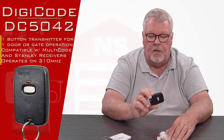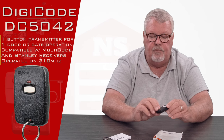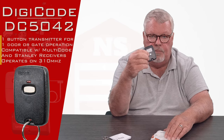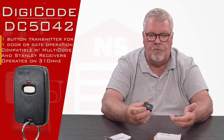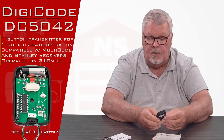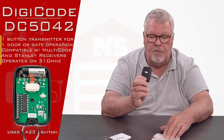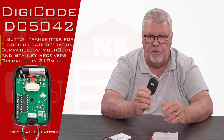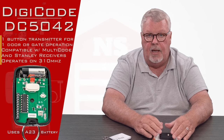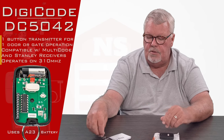You will need to take this apart in order to tune it in. There's a Phillips screw in the back — you'll take that screw out, the case will come in half, and it'll expose the battery. By the way, there's a brand new battery in there so you don't have to go buy anything, but there are dip switches in there that you will have to set. You're going to need to open up your current remote and find the dip switches in it, then set these dip switches to match.